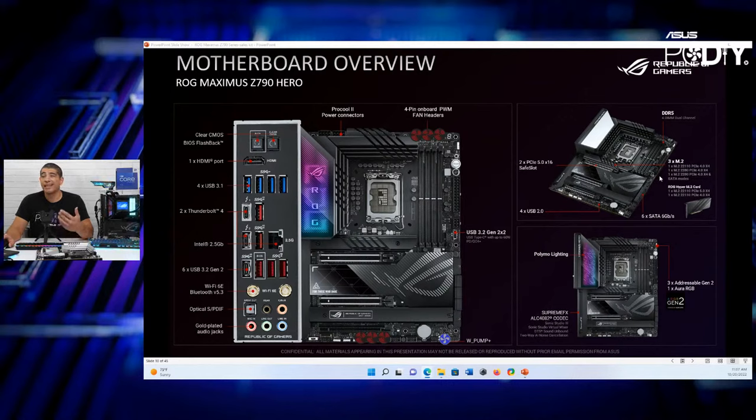For DIMM support, it's pretty much going to be the same in terms of what you can expect. So again, it will be realistic to see that you can achieve DDR5 7000 MT/s for a good amount of the actual memory controllers, and even faster speeds. You don't start to see the trail off probably until you break about 7400 to about 7800, where you have to have a stronger memory controller. But again, we'll talk a bit more about overclocking in tomorrow's dedicated overclocking stream.